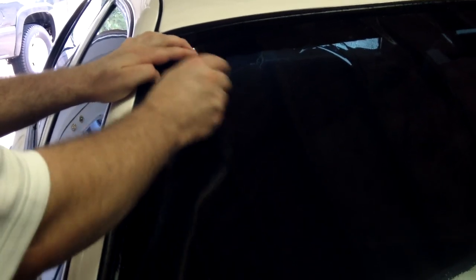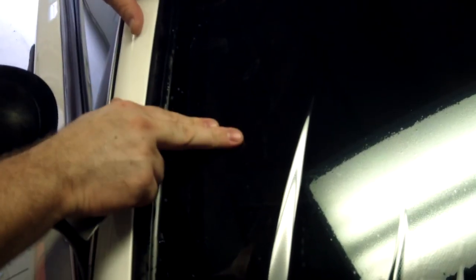This is a critical step. I see some fingers on the sides, and if I move them over they're going to become very large. This window on a late model Crown Vic is not so bad — I've seen windows that are much more curved. For demonstration purposes, I'm going to move and create some fingers on the side, because this is a wonderful technique for side shrinking. By creating small fingers on the sides — about two and a half to three inches — my finger on the bottom has decreased in size by half, which will make it easier to shrink. The small finger makes a huge difference, top and bottom, so it's cool to put small side fingers when you can.